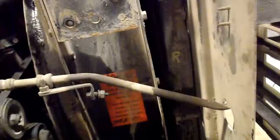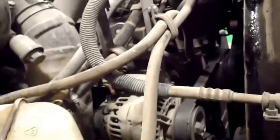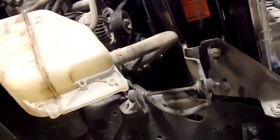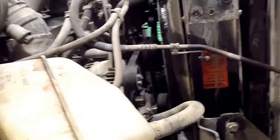Wear some gloves because there's no shortage of sharp stuff that you got to work around when you're taking these bolts out. Those little screws in there and stuff. I had left the grill and everything in. If I don't have to take that out, I'm not gonna. And that should give me enough room to go ahead and start working on that front timing cover. I ended up buying the special tools just because, as you know, there's a big shortage of everything lately, and it takes a long time to get stuff, so I had to actually order the OTC tools, the 20mm socket and the gear puller to get that.